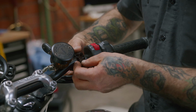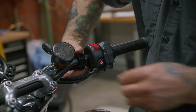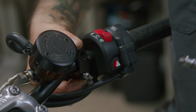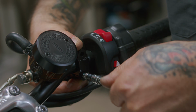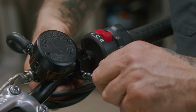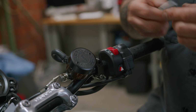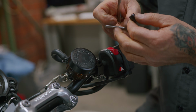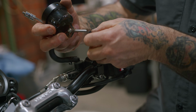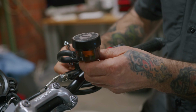Put the clamp kit. You want to hold it here. Start with your bottom screw. Install that. Using your 4mm Allen hex bit, you want to snug that screw up. Now you can let go of your master cylinder and it won't fall. Get the longer screw from the kit. Put it through your reservoir. And put the spacer so it goes in between.